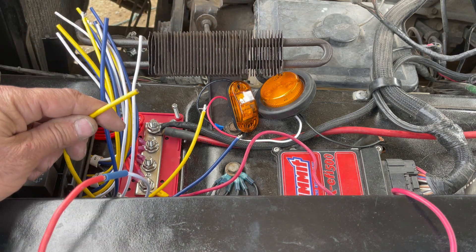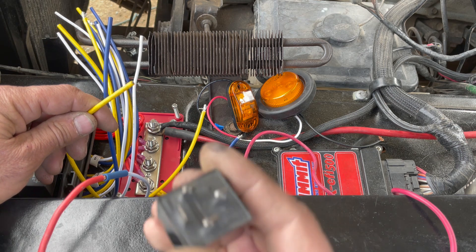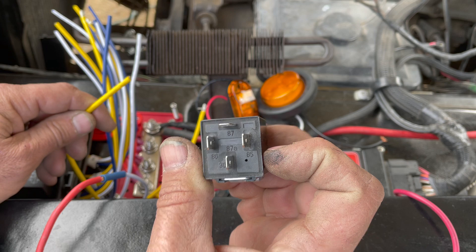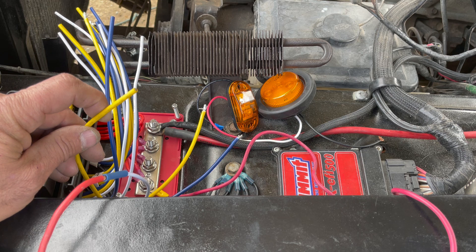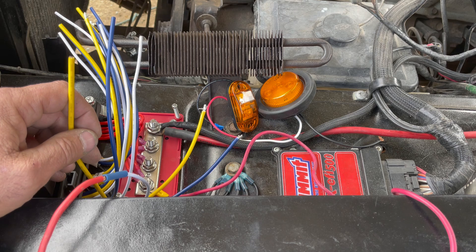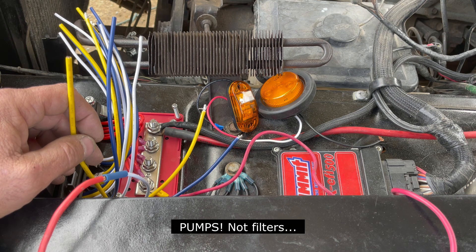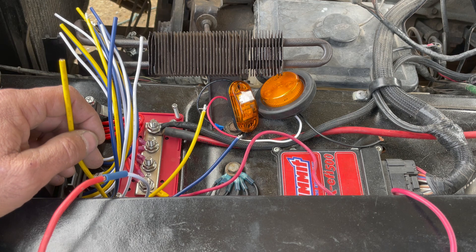This guy — the 87a — is located on the back of the relay. Most relays like this are four-pin, as you can see where it has 87a and there's nothing there. The TrueMods is a five-pin relay, so you'll get this yellow wire. It's kind of tricky because it comes on when the switch is off. Think of it like running two fuel tanks with two fuel filters — you switch from left to right: switch to the on position and the right comes on, switch off and the left comes on automatically.